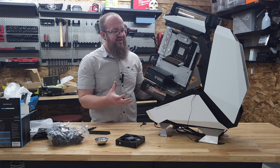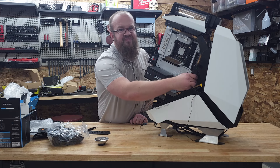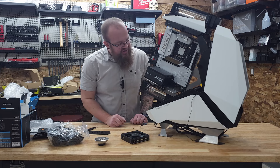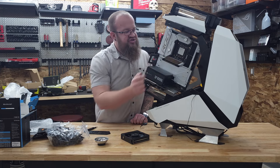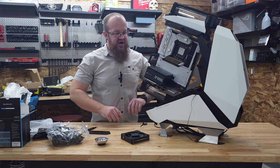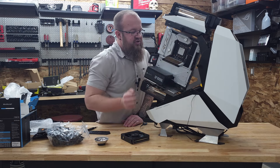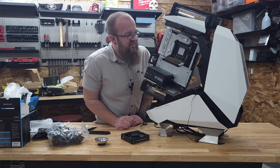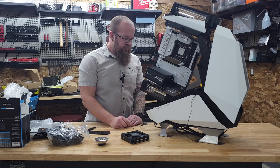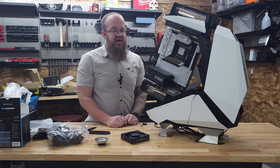This is crammed, and I don't even have all of the fans on there yet. I'm even tossing around putting a fan here — leave in the comments if you would or not. I was thinking about putting it there to run some air over the NVMe drives. If I go Gen 5, there's a chance that might not be enough to dissipate the heat. The fans down here are touching — actually, the radiator is sitting on top of the fan and there's no wiggle room to move it any higher. The bottom radiator is moved back all the way so I can't make clearance that way either.